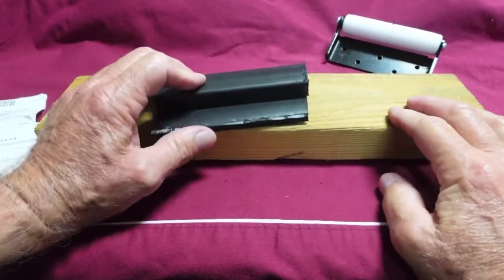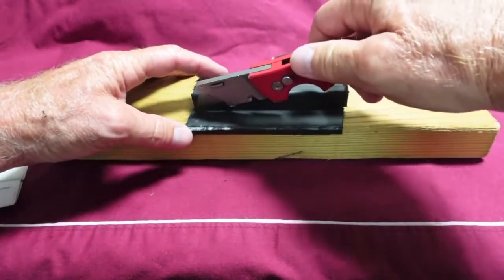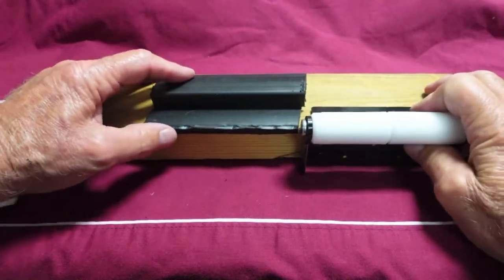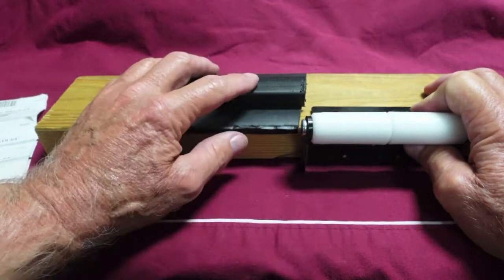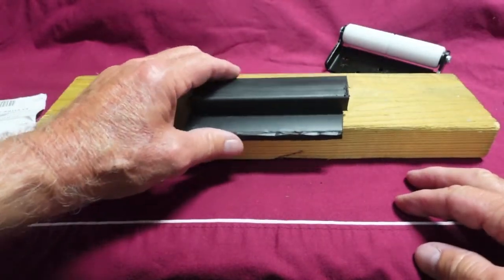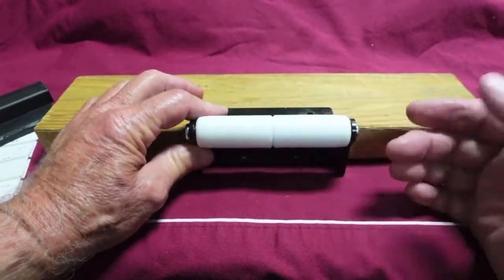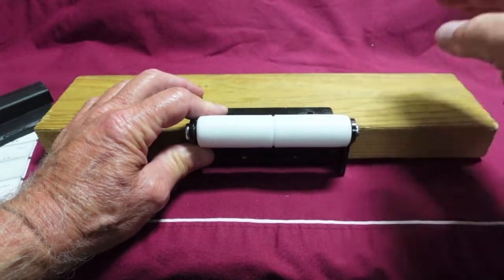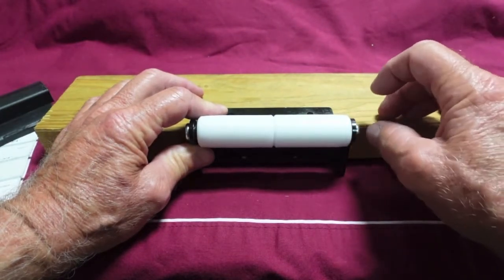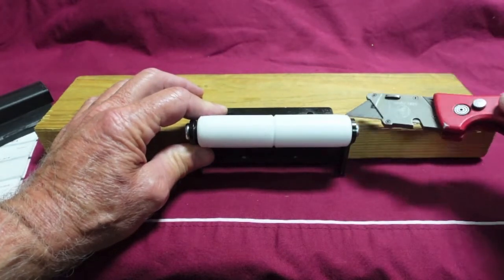This one is almost basically a new one, because there's no way, without taking the slide out, you're going to be able to get up there and cut this. Now you're perfectly in line, the same height as your wear bar. And by cutting this out, I open myself up to a big gap in there that's right into the carpet. So what I'm going to do, when the slide comes out all the way, I can just lift up my carpet. I'm going to get some self-sticking weather strip, some of the foam. You can get it 1/2 inch, 3/4 inch, and I'm going to glue a channel here.